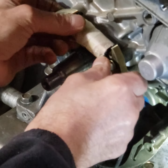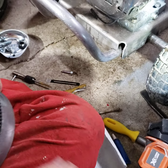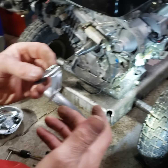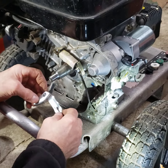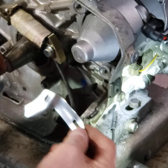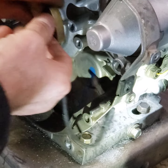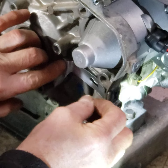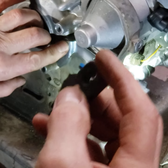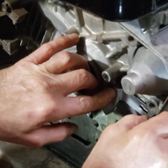Some people install this down here — you want to install it up top. The reason is there's this tiny little bracket here which nobody covers except the Russian people, so you have to watch the Russian video with the volume off. What this bracket does is protect your wire — if your wire gets caught up in your flywheel, it's over. Once you mount that bracket, your wire gets run behind here, and there's your pass-through in the case for the wire.